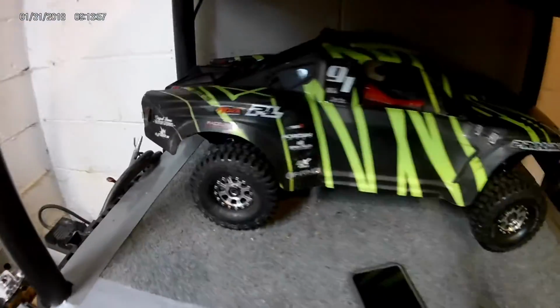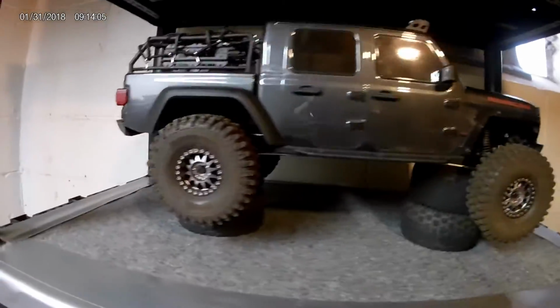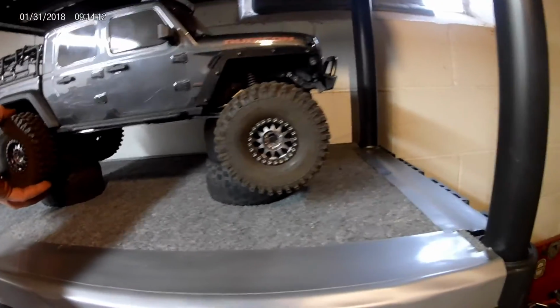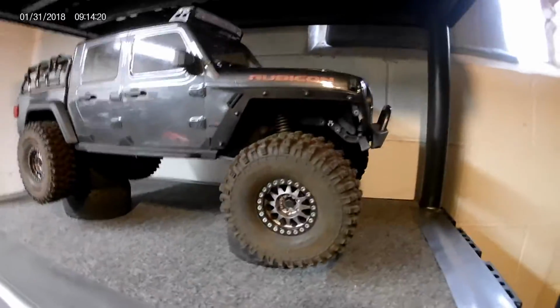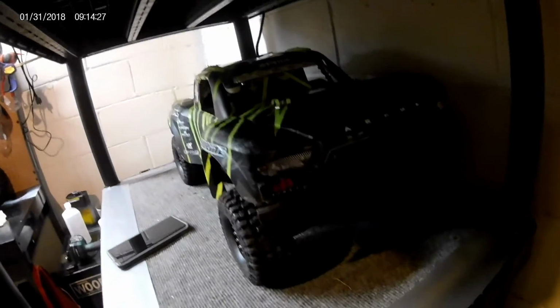I mean, you can really do it on any vehicle. You know, that's on my Creighton. This one's going to get it next, even though I just put brand new wheel bearings in this. I got Fast Eddie wheel bearings in this all the way around, but I'm going to do it on that next, and I'm going to do it on this guy. I'm going to let this guy sit on the shelf when it's stored, because these tires on this are so soft that they will flat spot. So yeah, pack a little bit of wheel bearing grease in there, and it'll help to combat the rusty, squeaky bearings while running your cars in the winter.